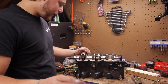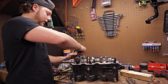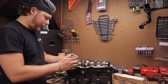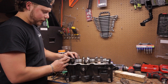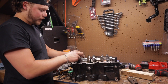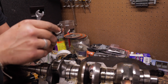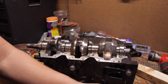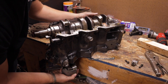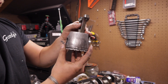I needed a 5/16 twelve-point socket, which I couldn't find, so I shaved down the end of a 5/16 wrench to make it work. I'm only pulling the one damaged piston today since the other cylinders look okay and the crank bearings look fine. With the rod cap bolts out, the piston falls down. This is a caged needle bearing — one half stays on this side. Slide the block over and put your hand under to catch the piston as it comes out.